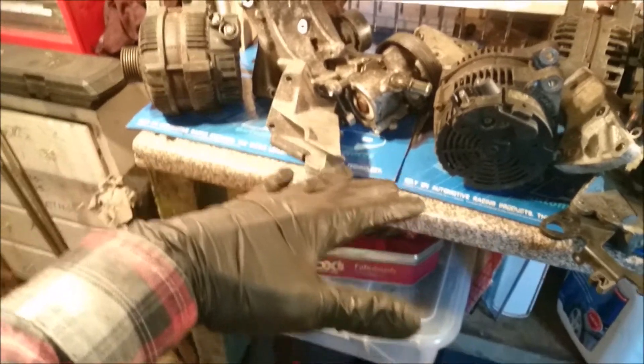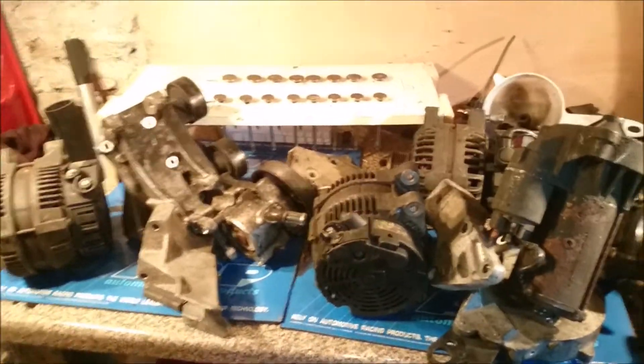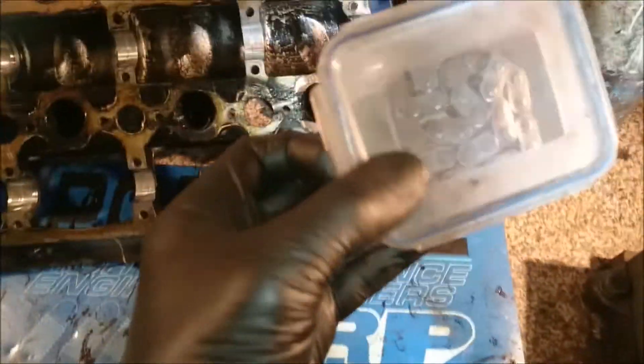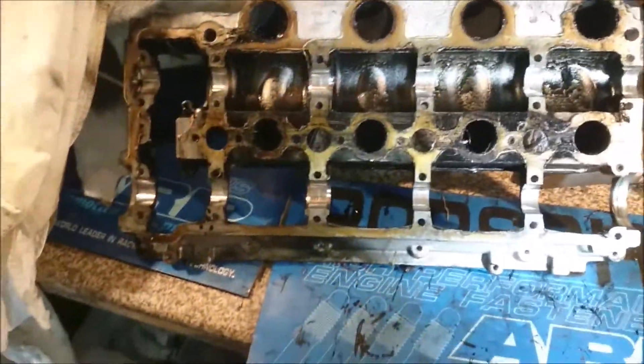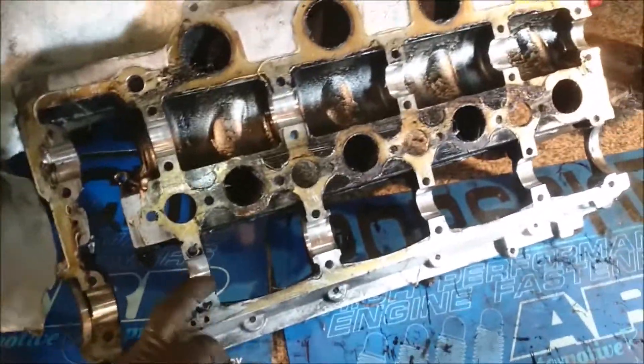I've got a box full of bits like the inlet manifold, which is kind of the carrier for the cams as well. The cams need cleaning up, bits and bobs like that - a lot of cleaning to do. When the head's back this weekend I can put it all back together, I hope. I got all excited - I had all the parts cleaned up, ready in little tubs ready to go. And then I remembered the inlet, which is also kind of the top of the head and the top carrier for the cam bearings. It's kind of all in one - nice little design.